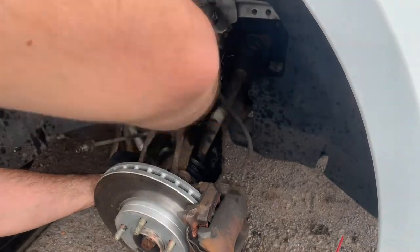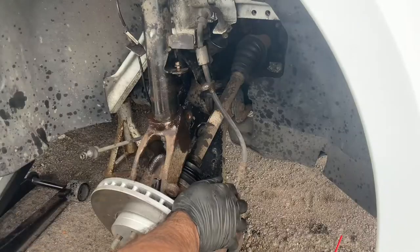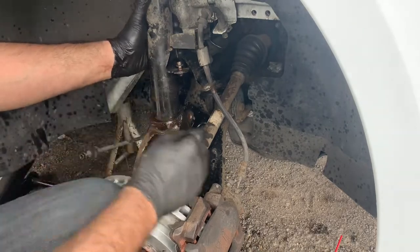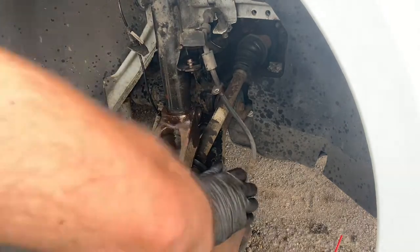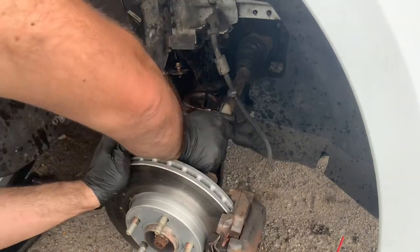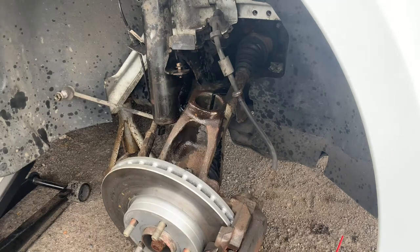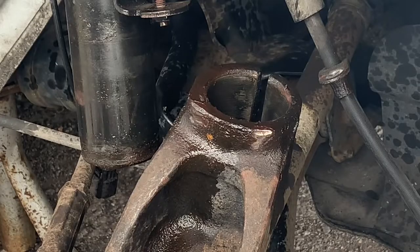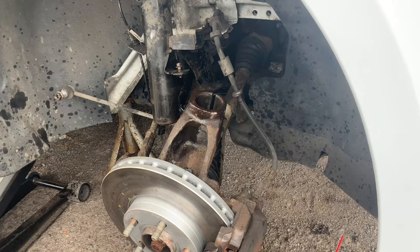It's starting to get a little bit looser now. Have to be careful not to extend too much the drive shaft — you don't want to pop it, but it can be a bit tricky. That wasn't too bad to be honest. I've seen cars where this is actually much worse, depending on how rusty they are around the collar, but yeah, not too bad.